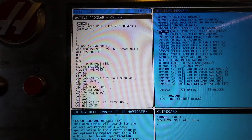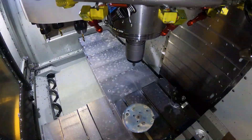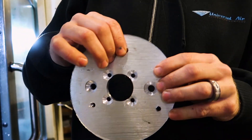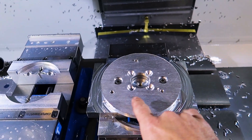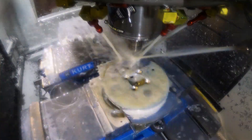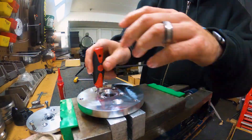We'll do a quick simulation of how it's going to look, then pop the three holes, open up the center for the pillow ball, and call it a day. After doing those three holes and the center section, we put it in and machined the top face and profile for the left and right sides. We pull up the offset left program first — these holes are offset to the left of the center hole. We have our strut mounts all built up, offset both sides just under three-eighths of an inch. Here's our set of custom cambered upper strut mounts ready for the Z4.